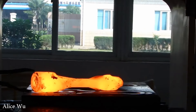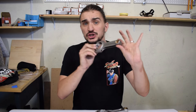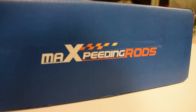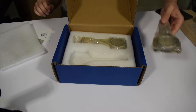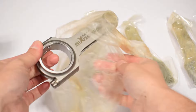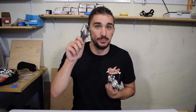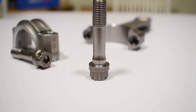At the end of the day, what's going to make or break the rod is also how you install it — the clearances and tolerances in your engine — because if those aren't on point the rod is going to fail, even if it's the greatest rod in the world. That's also why I chose these rods: they're very affordable budget rods but they're made from the right stuff and using the right manufacturing process. I would have chosen them just the same if they were an I-beam. Something else that's really important and can be more important than the design of the rod is the bolts — you can have the best design but if the bolts are weak the rod is going to fail.